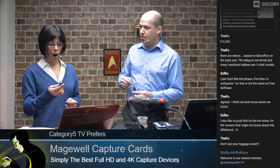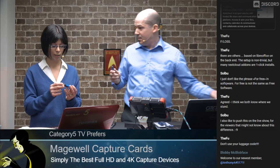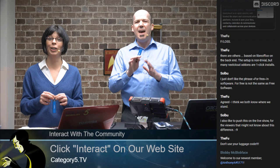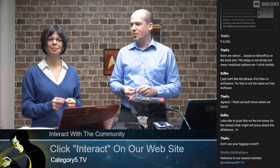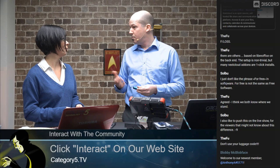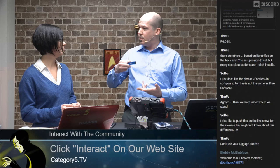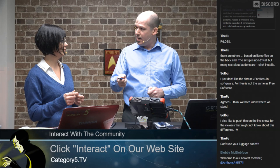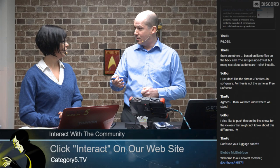This should never be the sole copy of your data — never have just one copy of anything. However, it's great for carrying encrypted backups. For example, I have cryptocurrency keys stored on my server with LUKS encryption and GPG encryption on the files themselves. I can copy those GPG-encrypted keys onto this drive — giving me double encryption — and if someone tries 10 wrong passwords, the keys are wiped from the drive but still safe on my server.